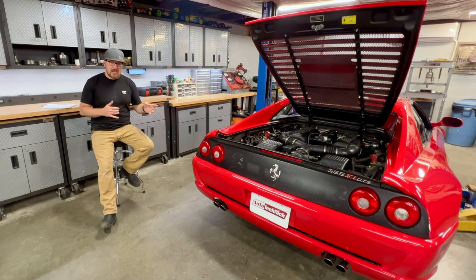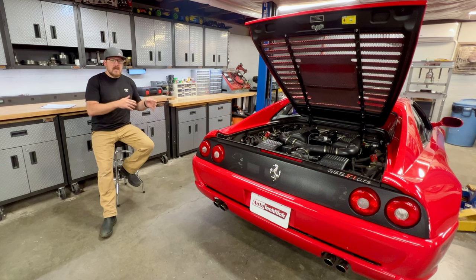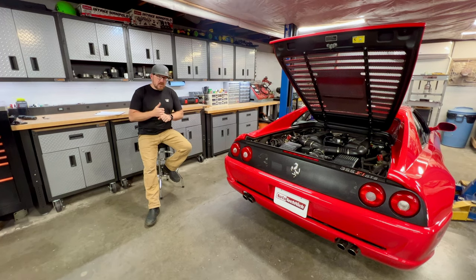We don't have any indication that leads us to think we need to do a leak down test. We're good there. As we talked about earlier, we will go back when we take the engine out and verify the cam timing to see if we can identify that discrepancy on the compression from bank one to bank two. The exhaust manifolds showed no cracks, which is great. That's a very spendy repair. And we see no signs that our catalytic converters have failed, although we'll have to do one more visual test when the engine is out of the car just to confirm that everything's good.